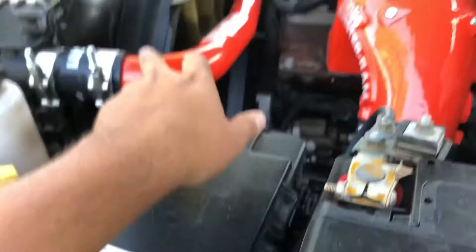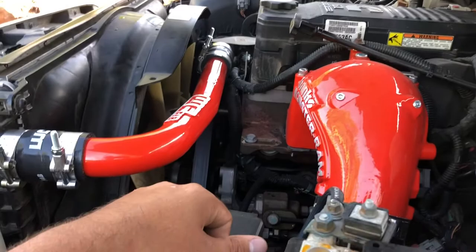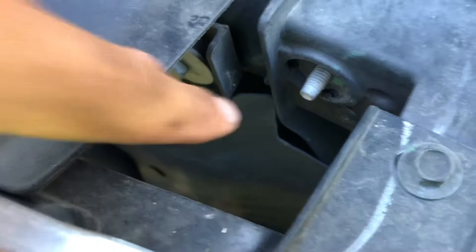In the instructions they tell you to drain the coolant. The coolant drain on these is kind of a pain — you have to take the grill off and then take off that plastic cover where my index finger is pointing. There's a petcock down there, but it's hard to see — it's above the intercooler pipe.